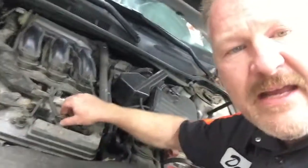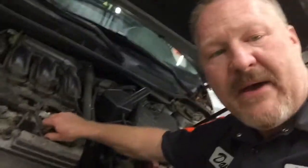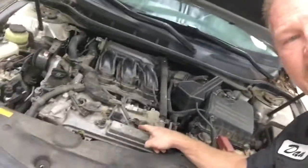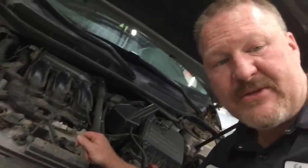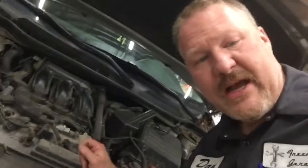I'm going to go ahead and seat that connector right back in there. That engine starts to hum a little bit better. It's not vibrating anymore. You can see that. Again, it was all because that connector, that plastic strip, that tab, was broken off. So we're going to end up having to rewire this and put a really good connector on that.